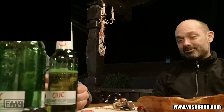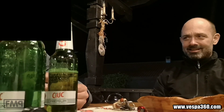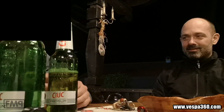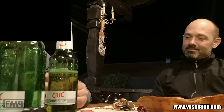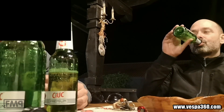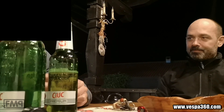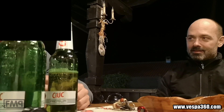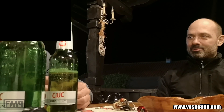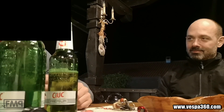There was a butterfly cut down to the exhaust port — what is that intended to do? He's opened up the top of the exhaust port a little bit wider than lower down, it's a funny shape. The idea is that it gives you more top-end while keeping some bottom-end, so more exhaust port timing without losing the low-end. It's a best-of-both-worlds compromise.